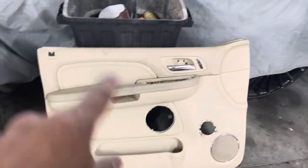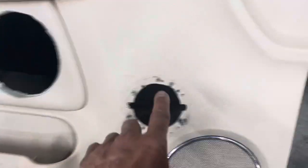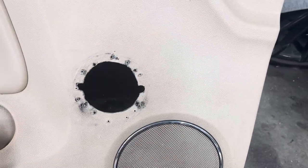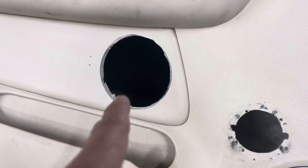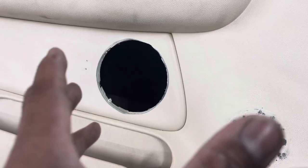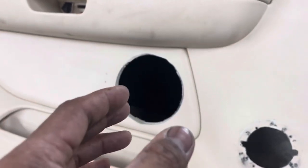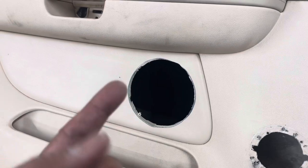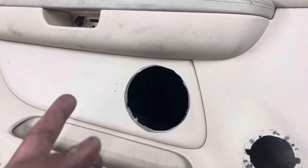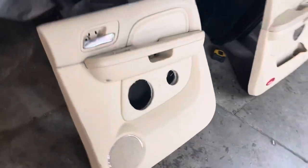Door panels — I ain't gonna clean them, just smudges and stuff. He has several different types of tweeters going on in there and I'm gonna fix all that too. In this insert right here, what I did was I made a plate that bolts on top of it, and then you can add whatever else you want in there — some fours, some five and a quarters. But today I decided to go with a six and a half and a tweeter, all by this company called PRV. If you wanna be loud, PRV.